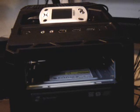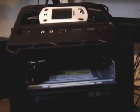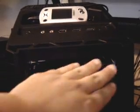Now I will show you guys how to install a CD drive. Most cases they come with an opening here; some you have to actually tap it out, others you have to screw it loose. Once you remove what's blocking it — the plate that's normally there — you can just simply insert your drive.